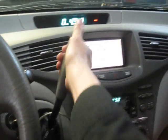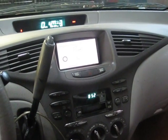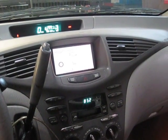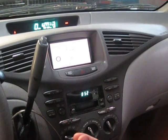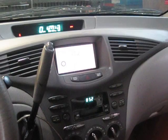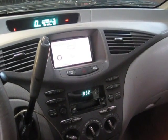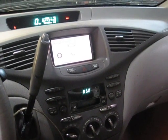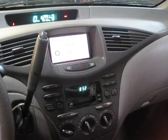So it doesn't really matter where you go — whether you go into park or drive or reverse, it doesn't matter. At this point, high voltage is going past the IGBTs, the transistors inside of the inverter, and reaching the transmission. So again, I'm going to wait 60 seconds. Actually, it's going to take less time than that for this to set.